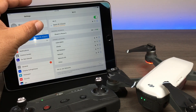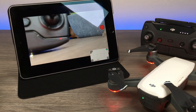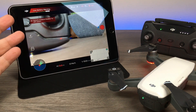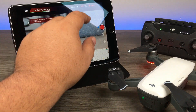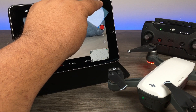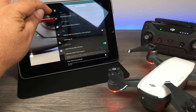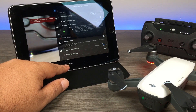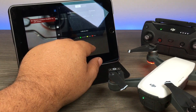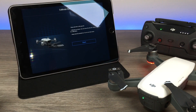We've connected to the Spark Remote Wi-Fi, launched the DJI Go 4 app, and hit start flight. It says I have a low battery but that's okay — we're not going for a flight, so we have more than enough power for the calibration. Click on the three dots in the top right-hand corner, then click on the little drone icon, and down near the bottom where it says sensors, click on it. You'll see a button that says 'Calibrate IMU' — click on it.